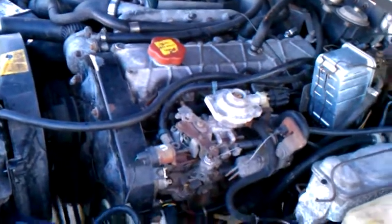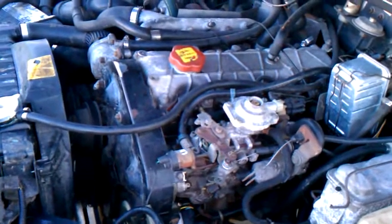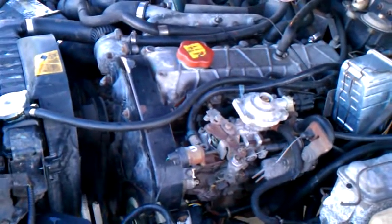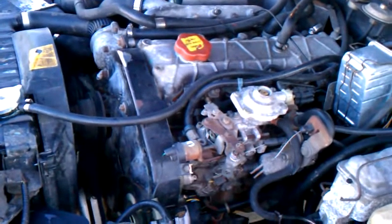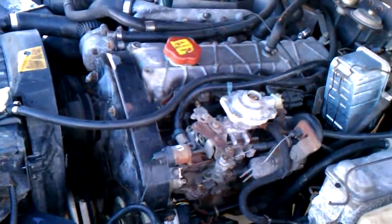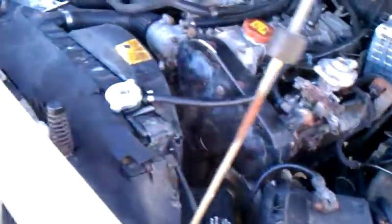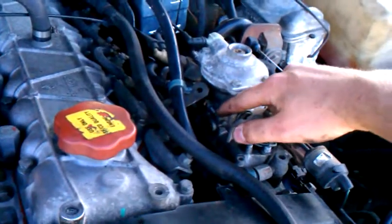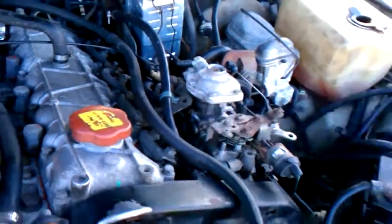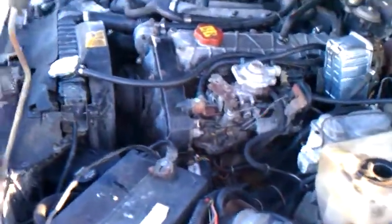What I actually had to do is turn up the idle way past where it was. I didn't initially want to touch it because I just wanted to leave the injection pump as it was so the tech could start from where it was left off. But in the interest of being able to drive it a little before I give it to him, I turned the idle screw up probably about a half inch — you can see it right here. There'll be pictures on the thread of how much I actually turned it up.